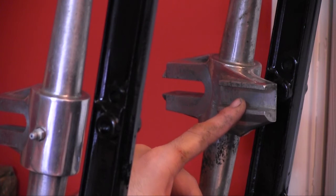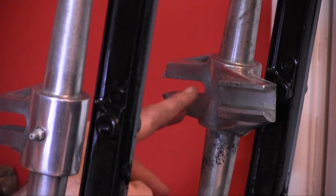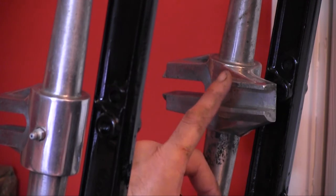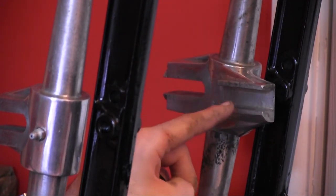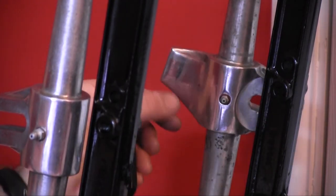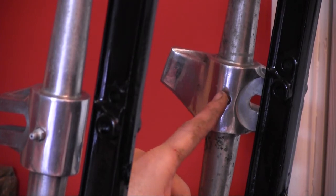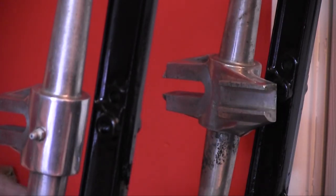For 30 years or so, the brake plate was relatively standard in its shape, a pressed steel brake plate, 7-inch shoes, single leading shoe. But there were a few variations, and one of the variations was the plunger ones have a square peg on the brake plate which slides into this. Turning it round, this grease nipple is also an original one, but different again, slightly smaller, but it's fitted anyway.